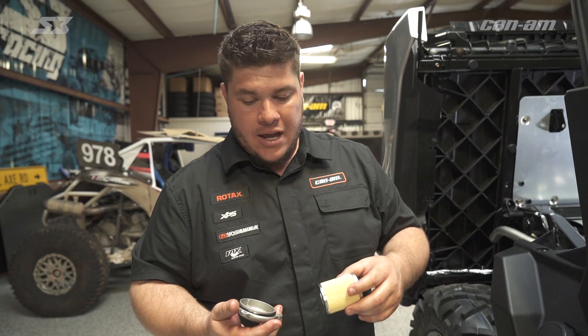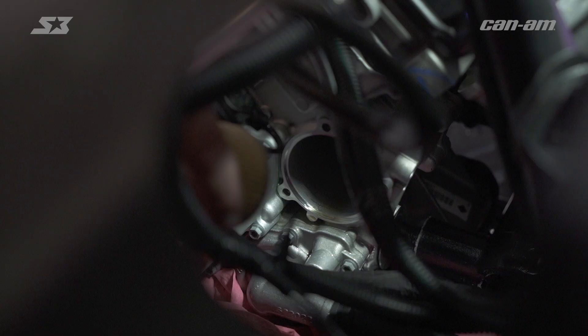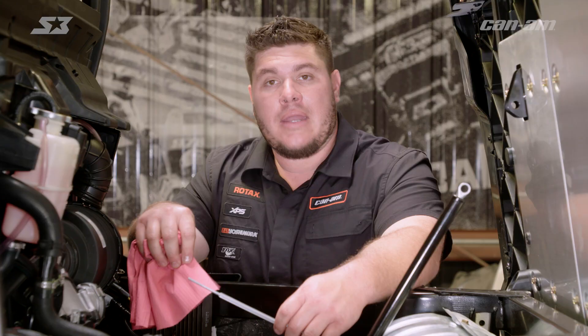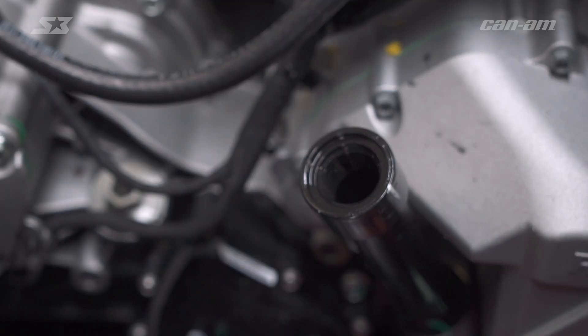You need to lube up the O-ring that's on the end right here — this is going to slide over the shaft that's on the case. Now you can take your oil filter and stick it inside your cap, make sure it's nice and snug, and go ahead and slide it on the case. Then grab your three 8mm bolts, stick them back in and tighten them down.